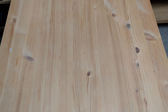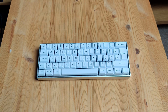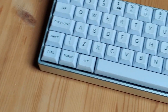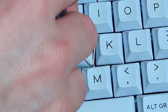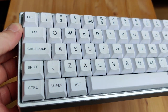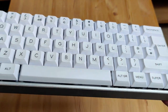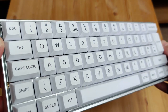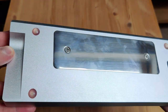Even though I'm fairly new to the world of custom mechanical keyboards, I actually bought my first keyboard last year. It uses the GH60 PCB, DSA dye-sublimated keycaps made from PBT plastic, and genuine Cherry MX Black switches which I lubed with Tribosys 3204. And even though the typing experience overall was very very nice, the only problem I had was the 60% layout. I just couldn't get on with it, having to access the function row through a separate layer which I forgot to toggle on and off.